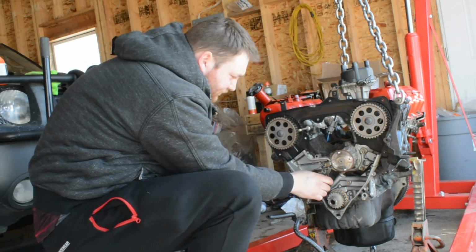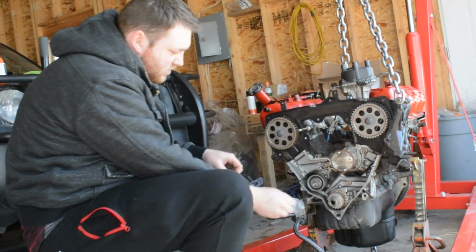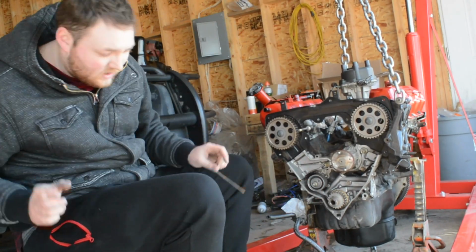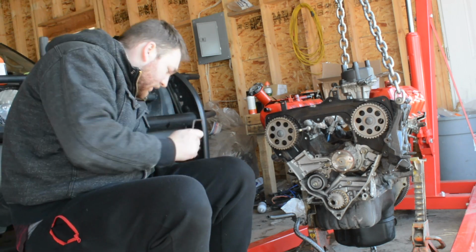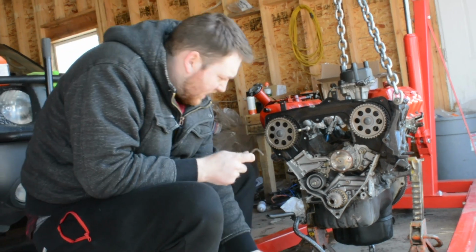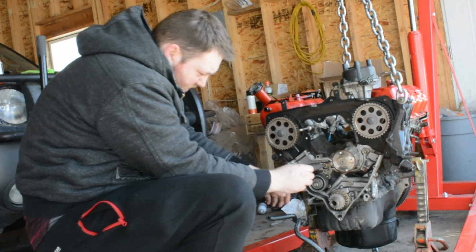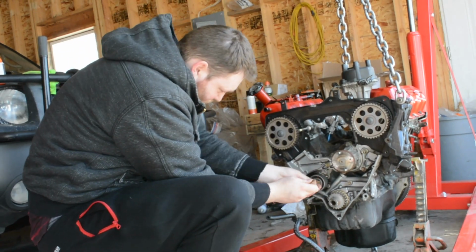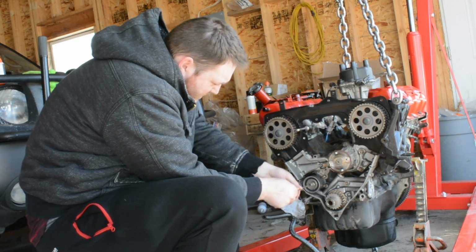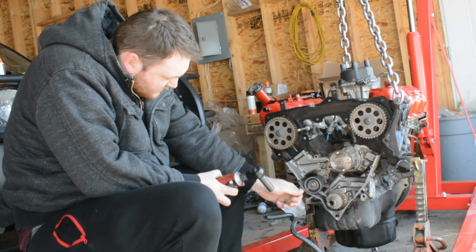You've got a spring. The spring goes over top of the stud, just like so. We're gonna have this nut almost tight. I'm gonna grab a ratchet, make sure it's tightening, and with this Allen wrench, it's a 5mm. You're gonna stick it in the hole here and turn that sucker all the way around so she's as loose as possible.